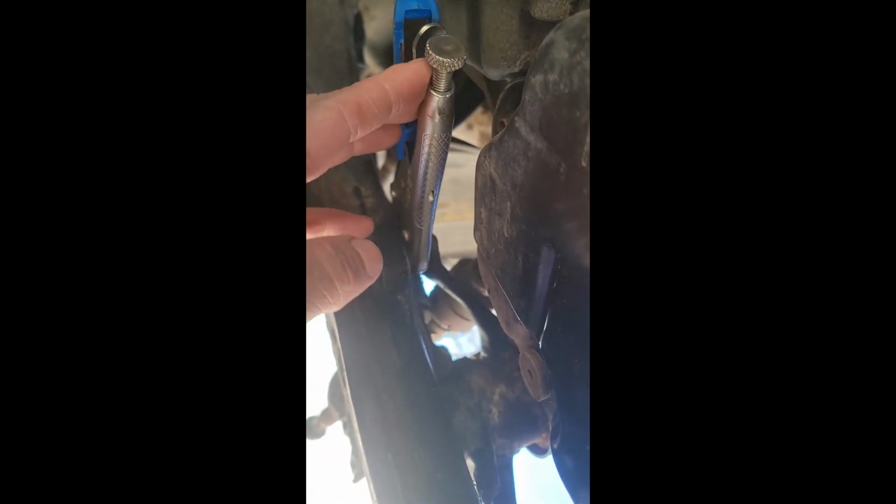So I ended up snapping the little mini hacksaw. It just came loose and bent, so I'm trying to tighten that back up, but I was actually able to get the vice grips on that bolt, so it's actually spinning. The vice grip is holding it while I loosen it some more. The bolts are kind of rusty and long, so they're difficult to get off without the top spinning, but with this holding it, I should be able to finish it because the bolt's almost off now.